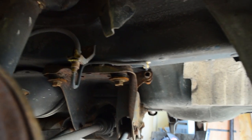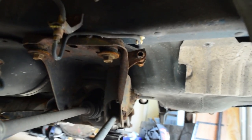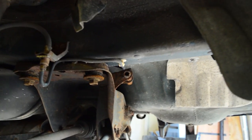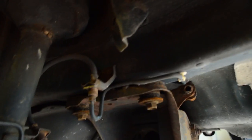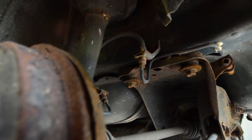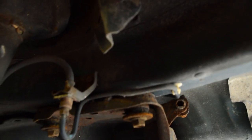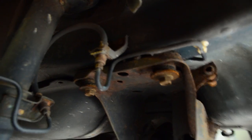Those are the bolts coming out next — they basically connect the subframe to the actual frame of the chassis. They're two 17mm bolts with a bunch of washers and bushings. It needs to get hit with an impact but my impact won't fit up in there, so I'm going to use a wobble extension for the first time. I imagine there's some serious torque on these. They're pretty rusty, but I'm just trying to get this thing ready to go to Jerry's.